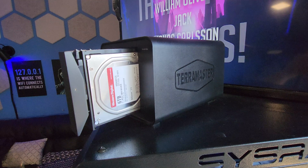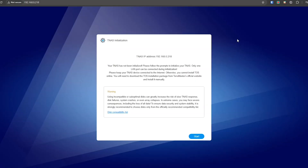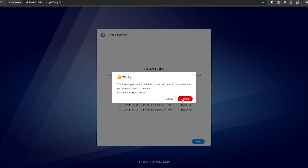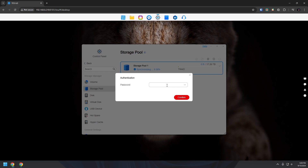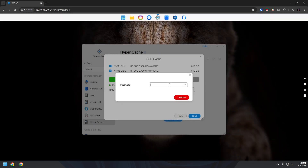Now that we've taken a look at the aesthetics and layout, let's talk about the setup process. I put four 6-terabyte hard drives in it along with two 512-gig NVMe drives and powered up the device. Going through the setup process was actually pretty straightforward — almost too straightforward. By default, the system set up the device how it thought was best and put all four hard drives and both NVMe drives into a single storage pool. After I noticed what happened, I destroyed that pool and reconfigured it as four 6-terabyte drives in a RAID 5 with the two NVMe drives as a caching setup.